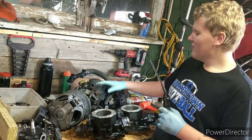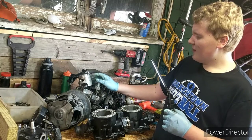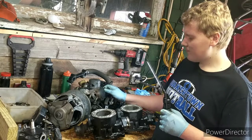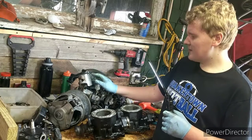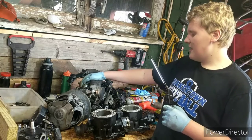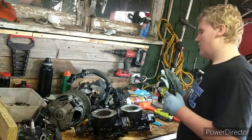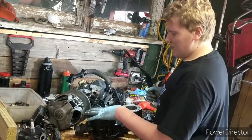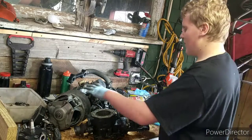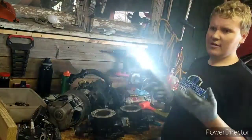Whenever you open up a motor and you see that this piston is scored along with the cylinder walls, and then you open this one up and think it's fine, but then you see the piston is broken, it's obviously something had a catastrophic failure in it. I believe it was this piston. Well, I believe all this stuff happened before I got it, which could have been why he was selling it. He said it hasn't really run in 5 years, which I do believe him on that, but that could be why this sled was parked. And it was only registered 1 year. It was registered '86, '87, when the sled was brand new. I doubt this motor went bad in '86, but it could have been. It only has 800 miles on it, so the sled could have only been ridden 1 year.